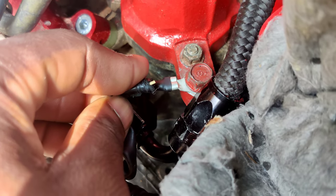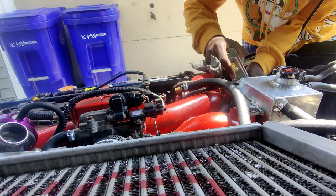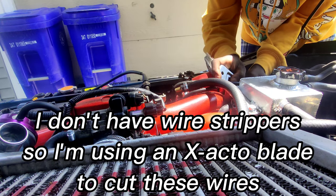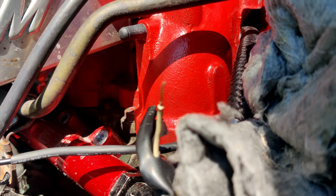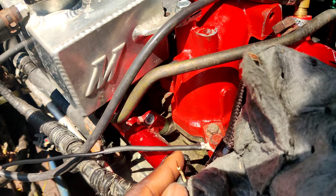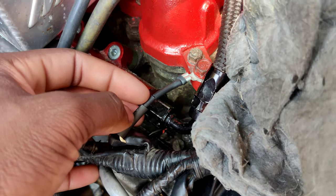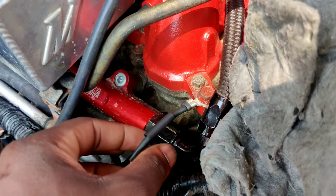Shout out to Jake — he made me a new ground wire. Now I just got to cut this so that it's not extremely long, and I have some heat shrink right here so that I can just attach everything. I have both of the exposed copper wire on both ends kind of just entangled together. This is a heat shrink wrap right here — I have them both in there entangled, then I'm going to put this heat shrink wrap right over it.